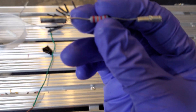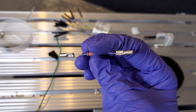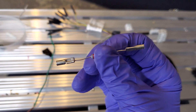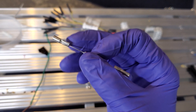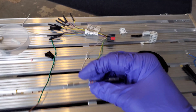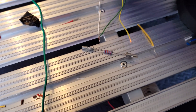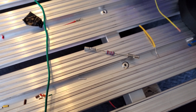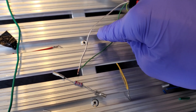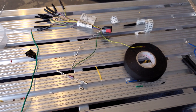What we've got right here is a 22k ohm resistor. I'm going to put a link in the description where to get these — I've had this for probably ten years, bought a pack of five. Now I've got a Super Duty and I'm going to do mine. We are going to splice in this resistor between the green and the white-and-brown wires — splice those two together with the resistor in between.